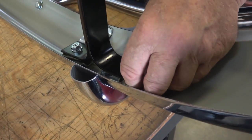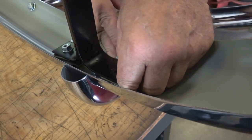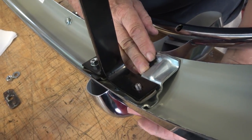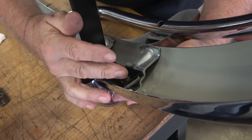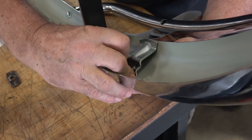Buy four of them for the bumper. You're going to want to put them in between the bumper bracket and the bumper spacer — those retainer spacers, the silver curved ones you see there — and put them in between. What this will do is push the bumper outward a little bit so the deck lid will clear.